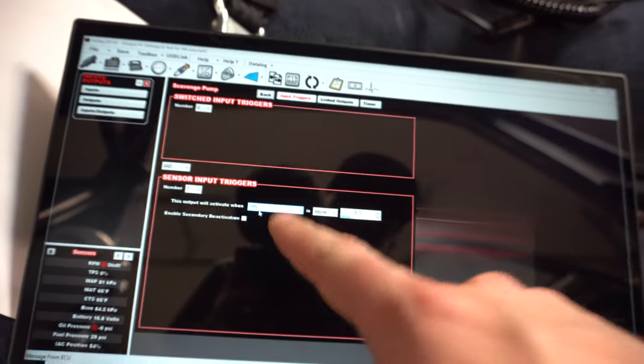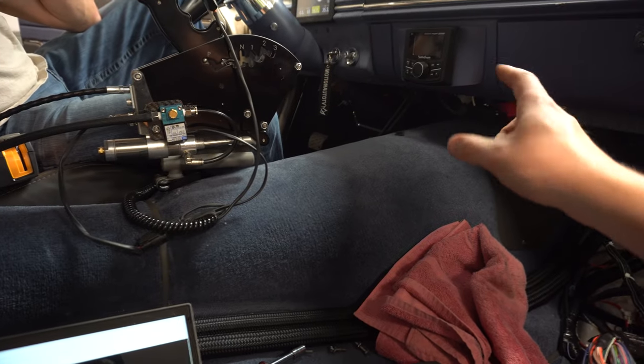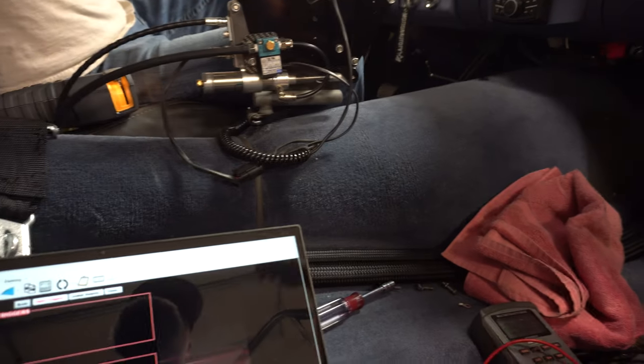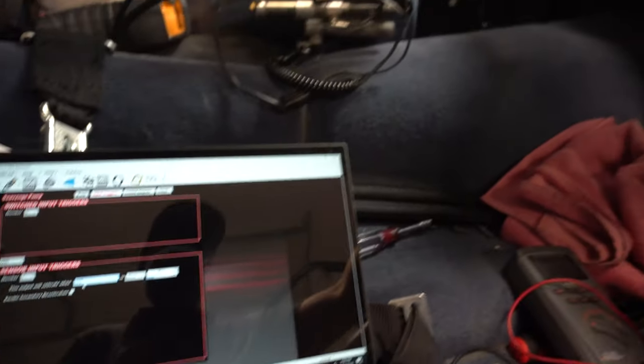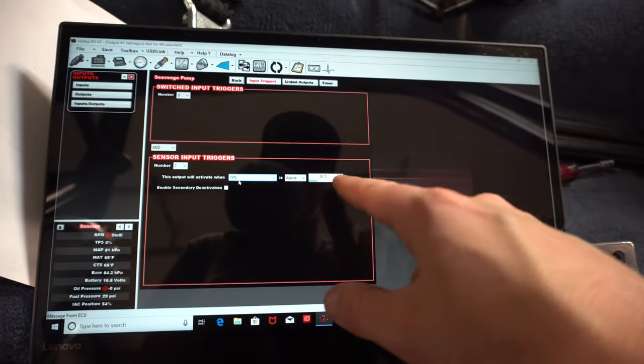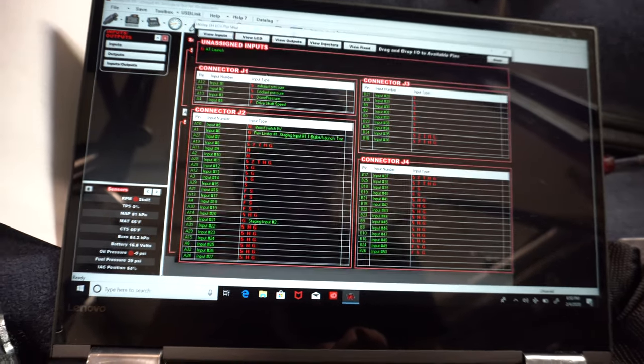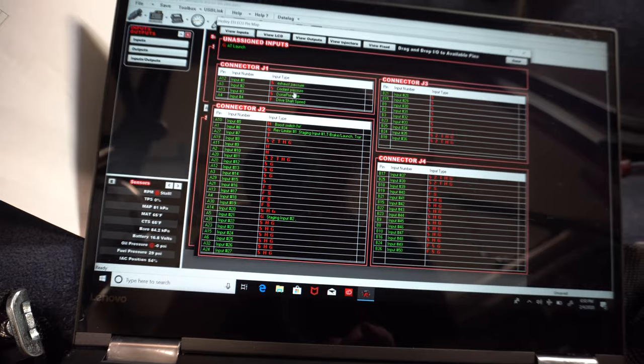And to test this, we use TPS. This is the best way to do it. You have a switch there that you can roll on off, set a stop start point. So then as this ECU cycles, it doesn't just kick it on and keep running it. You kind of have more control off of turning it on and turning it off with the pedal. So TPS above 30%.